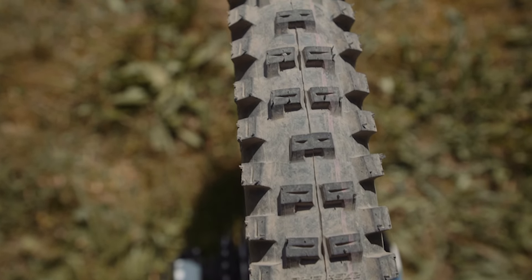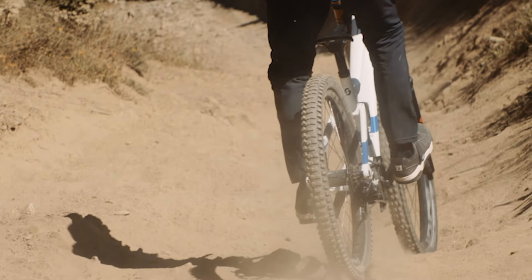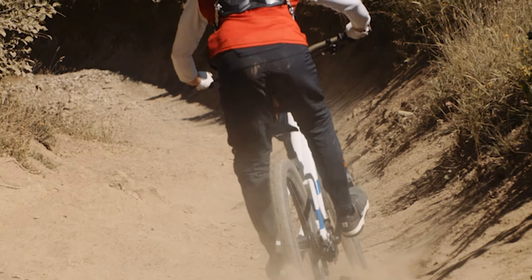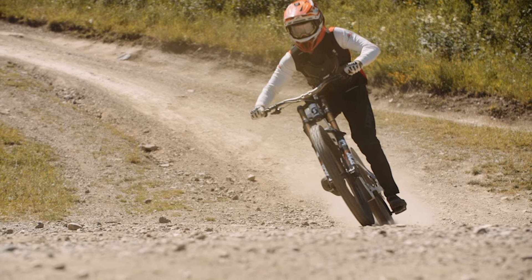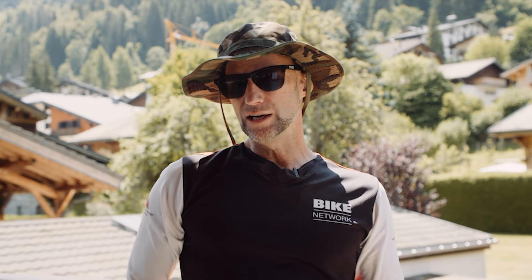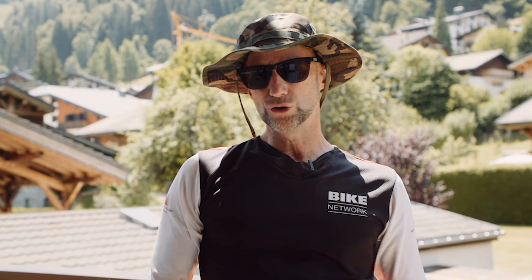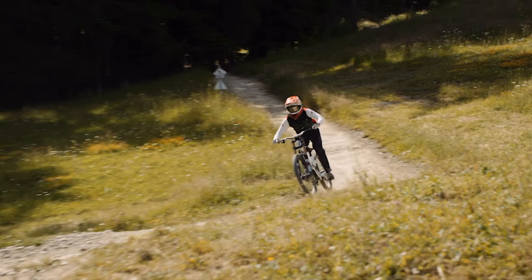The Big Betty is an excellent choice for the rear. Tall and slightly wider spaced knobblies cut in and bite under braking — excellent braking power on offer here. It works well in the wet or dry, hard pack or loam. Almost nothing stops as fast as the Big Betty. Sizing wise these are 2.4 but measure up as what most brands are labeling 2.5s. I'm usually a big fan of tire inserts but with these Schwalbe super downhill casings, they've got six layers up top and two in the sidewall and you probably won't need inserts.